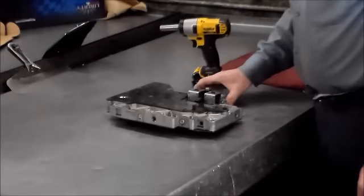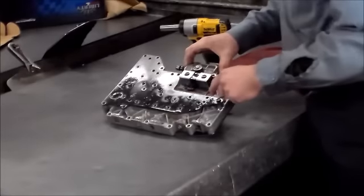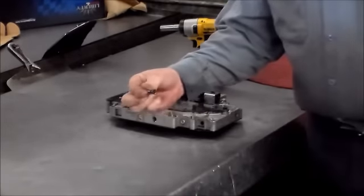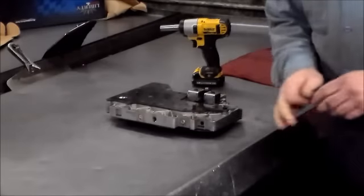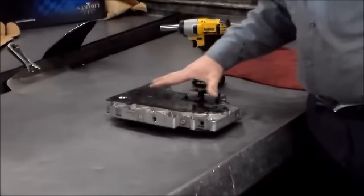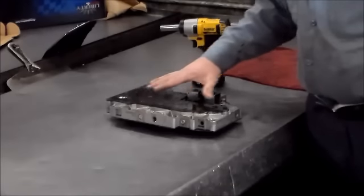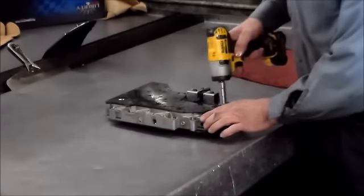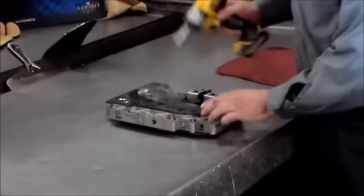Now this top plate here, there's 2 bolts in it, but there's many of the 10 millimeter bolts, but just to save some time I had taken those out already. And these are the 2 like line-up bolts that line up when you would put it in the case. There's an indent in the case. So let's take those out, and we'll take this top plate. Okay, that's what these bolts look like. It's a little pin that goes into the case to line up.